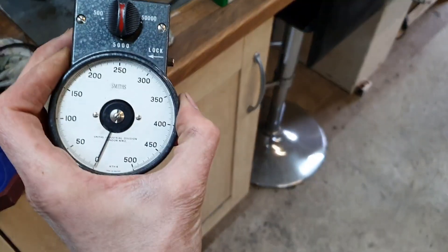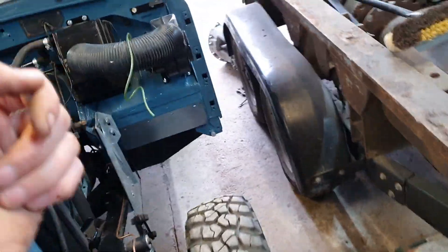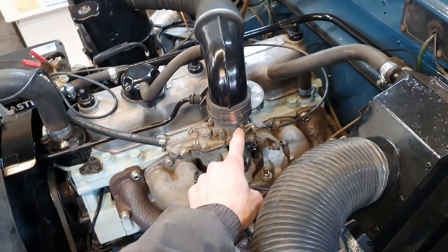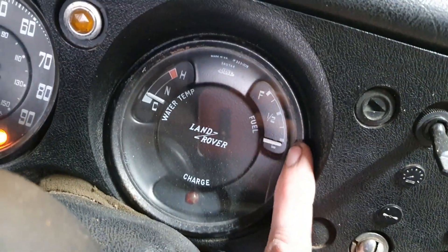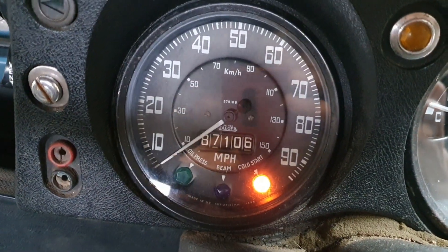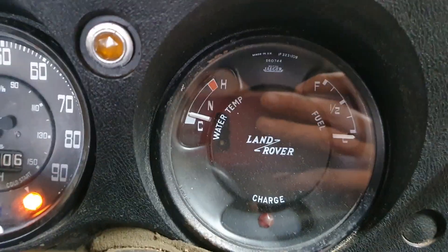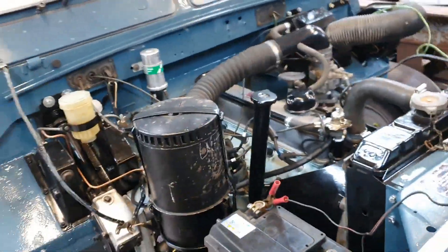I've used my RPM gauge here, which is a lovely little thing. It tells me it's at about 2000 at the moment — a fraction low. I'm using the early stages of the choke, which just hold the accelerator open rather than the choke flap itself. The expansion tank still hasn't got anything in the bottom of it yet. There's five litres of petrol in the tank which I've tested, and that gauge is still reading empty — so it's nice to know when it gets to empty you've got five litres. The cold start light is on but nothing else. I cannot believe how quickly it ran — it just went straight into life. I'm so pleased.